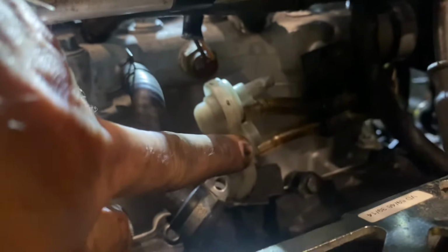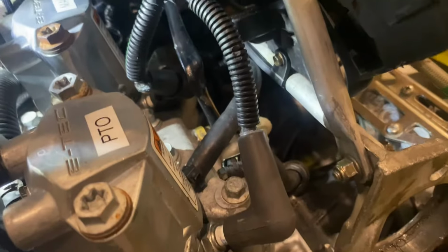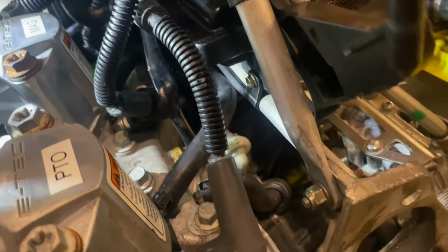And then guess what? Just this morning, I broke right here. You've got this little white plastic. These are your vacuum lines. They take 2 lines in, and then they go 2 lines down here, which feed down to your bottom crankcase. And I broke that off. And the reason why I was going back to take these off was because when I put my jack shaft in, your shaft goes along here and feeds out to your chain case. And when I did that, I noticed that this white collector box and the vacuum lines were rubbing on the jack shaft.